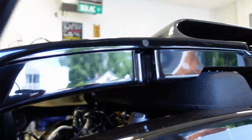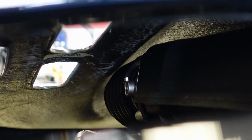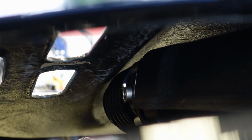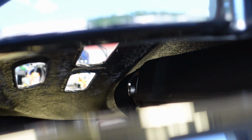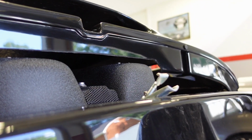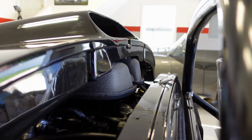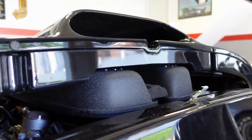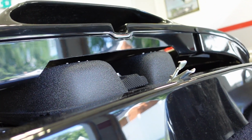Let's take a look. This side isn't as bad because again the throttle body's inward instead of outward like it is on the driver's side. So I don't think this side's going to require too much. So I could just put another vent hole there just for symmetry if I wanted. And here you can see the spacing again because I'm hitting on the throttle body. That's not coming all the way down, but I think that will come forward enough. Once I make room, it will clear that. If not, just trimming up a little bit higher, I think will do it, but pretty close there.